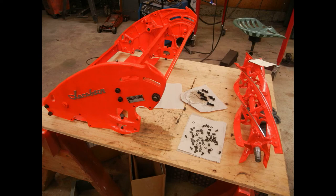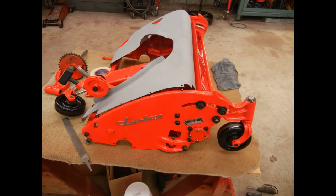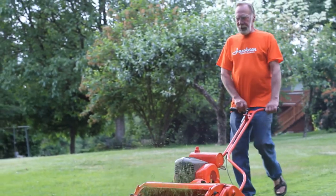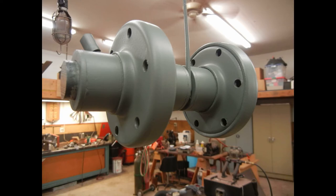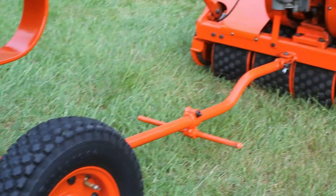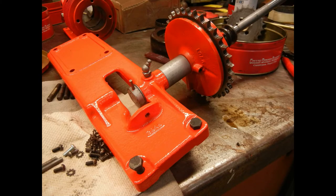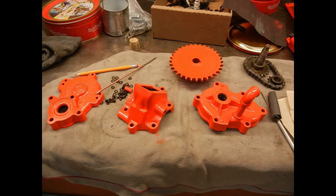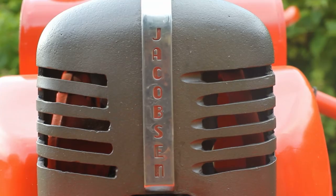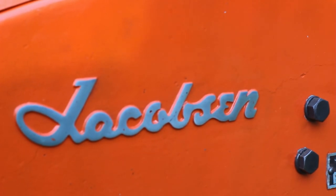Teardown. The muffler and expansion chamber have been rebuilt. The four-wheel drive was an option — the standard was two drive wheels, and the option was four drive wheels, which this one has. I had some coils from an old lot light where I used to work. They took all the old lot lights down and had some transformers up there. I set up a thing where I could re-magnetize the flywheel magnets, check the polarity of the magnets and the flywheel, and reverse them so plus equals minus. Fun stuff.